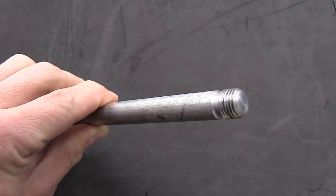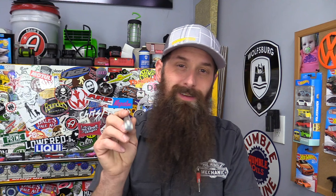Finally, one I probably should have started using from day one — a wheel holder. This one came out of a Touareg I ended up totaling many years ago. It screws in where a wheel bolt goes and holds the tire on, similar to how stud-based cars let you set the wheel on and it'll hold. It makes putting the wheel on so much easier. There are multiple sizes: this is 14x1.5, which covers pretty much everything Mark IV forward. There's also a 12x1.5, more for older VWs, though I believe BMW still uses 12x1.5. You'll know right away if you have the wrong one — it won't fit.